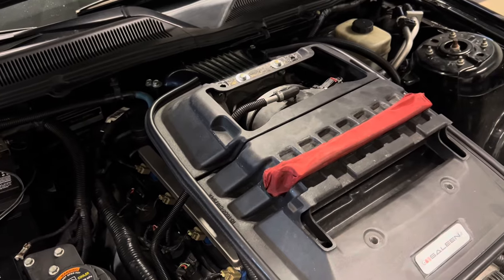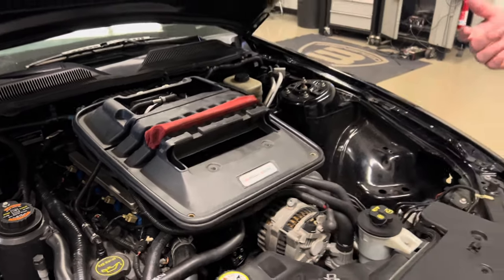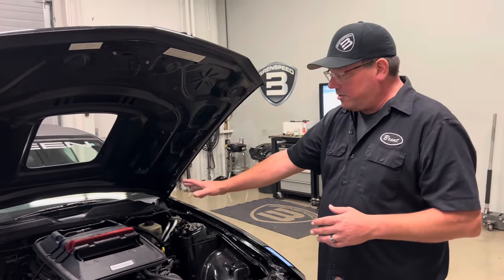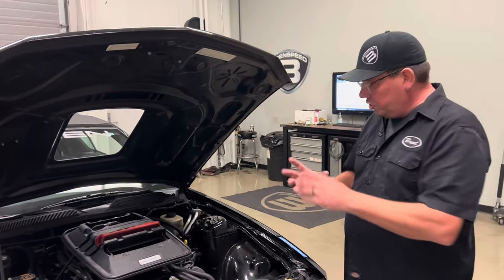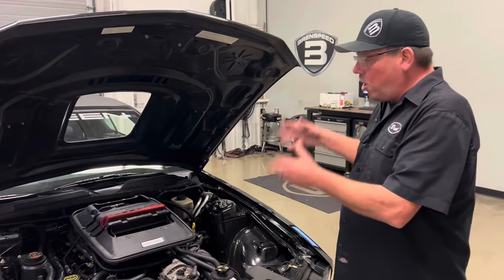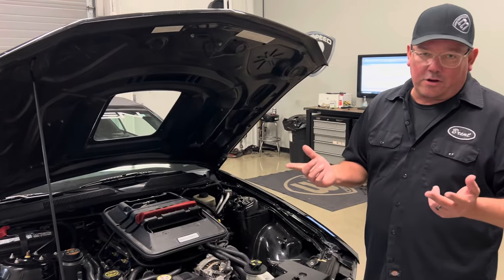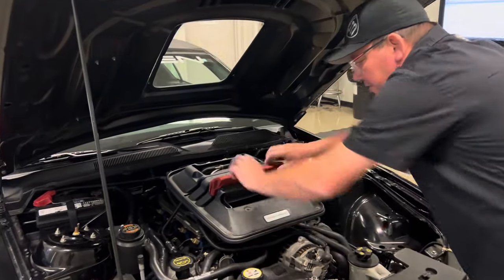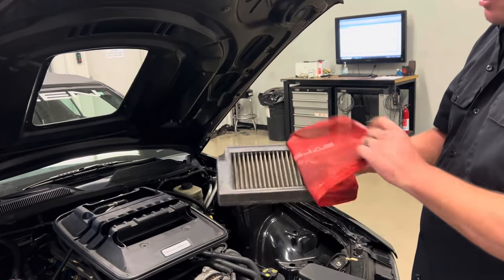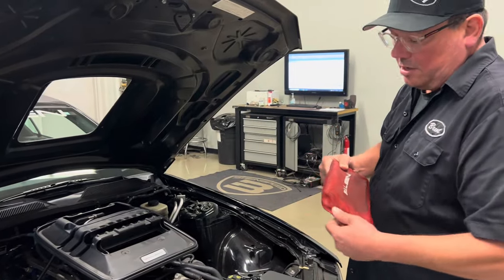So here's what's going on. When Saleen did this — I think it was around 08 or 09 when they came out with it — they wanted it through the hood, which is awesome. But they had to worry about rain coming into the engine, so they made a rain guard. Typically on all of our superchargers, whether the standard Saleen with the big inlet in the front with a giant air induction system, or the old Whipples — everything's all about induction. But they couldn't do that here because of rain. So what they did is basically a two-stage filter: one main air filter plus a pre-filter. I'm going to pull this out and take a closer look. What you have in here is this little pre-filter to keep debris from coming into the engine, and then your main air filter.